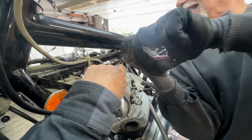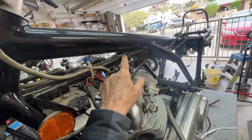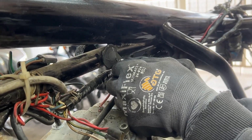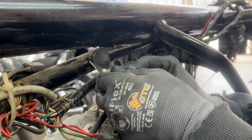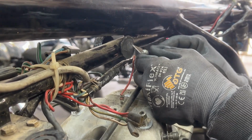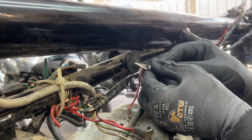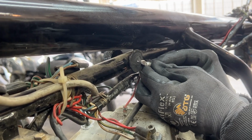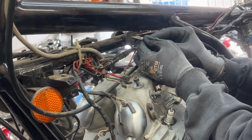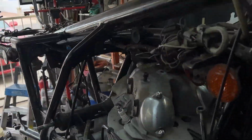Okay, there might be a bolt head inside underneath of this rubber. Let's double check that because these things are in here so tight. Oh, yeah. This is something where you simply unscrew and remove. And here we are carving away rubber to try to get to the metal, because I have in the past, while trying to unscrew these, broken one off and then had to drill out the threaded part. And it's a total pain. So anyway, this is the fun part of this job. Taking apart 50-some-odd-year-old parts that basically don't want to come apart.